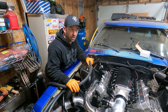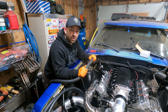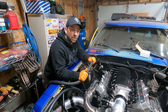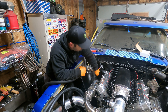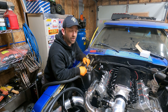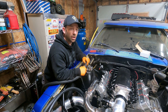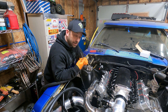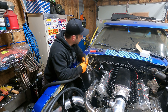Change of plans — I had the intercooler water hoses run under the car, but I decided that was a horrible idea. I was talking so much earlier about not having water get under the rear tires, and then I looked at the hoses running under the car and went, yeah, this is stupid. This is going to be a street-driven car and we'd end up ripping hoses. So revision number two: we're going to run them through the firewall and along the rocker panel inside the car. It's not an interior car, so whatever. With the hoses inside, the whole water-leaking problem isn't a thing anymore.